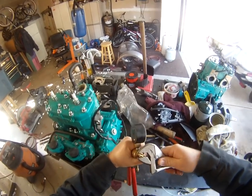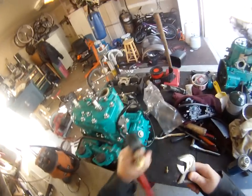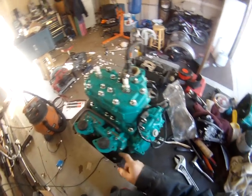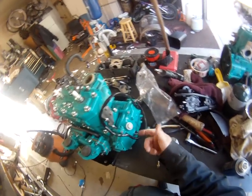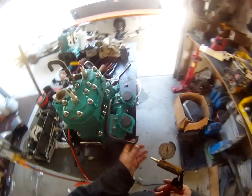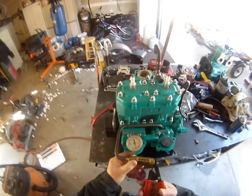We're checking to see if our seals are good and whether we have an exhaust leak, because it could leak right in here at your reed valves, the gaskets, the seals inside the engine. I have the oil pump off on this one, but that's okay because we're just checking the seals in the front and the rear of the engine and checking the exhaust. So what you want to do is hook the gauge up and start pumping.